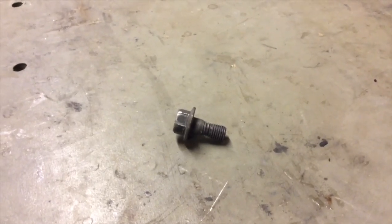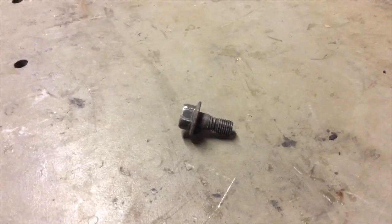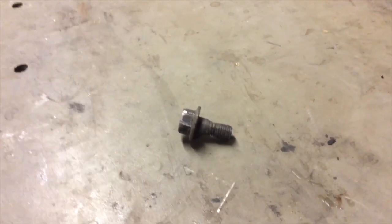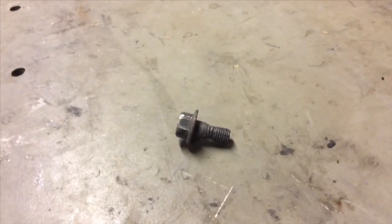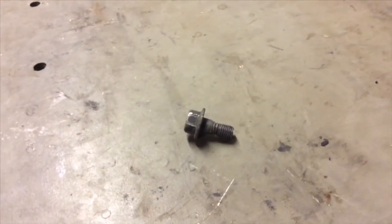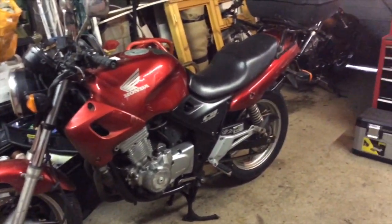That bolt had elongated in twisting and then it wasn't seating properly. Replace that — not a moment too soon. It was about seven or eight quid for the bolt. I could have got a cheap aftermarket one, but it's a sprocket bolt — you need the right thing in terms of strength of material. OEM is the only way to go with that one. You have to pay top dollar to get the quality parts. Anyway, that's all back on, torqued up at 55 newton meters. Obviously check your own service manual if it's a different bike, but all done — just need to get out and have a play now! Thanks for watching.